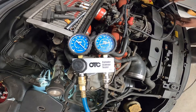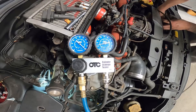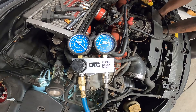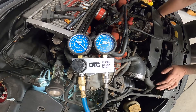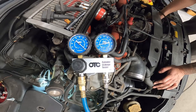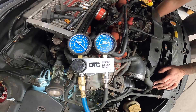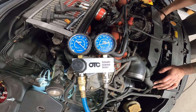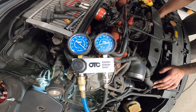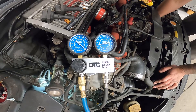Okay, so this is the next cylinder, so again I'll hand crank the engine from the crank. You have to have your car in neutral or else it will try and run you over. And we'll keep going until we start to see the pressure go up. That means the valves have closed. I'm hoping I don't find any inconsistencies. It's just I was replacing my spark plugs so I figured I would do a little engine health test.